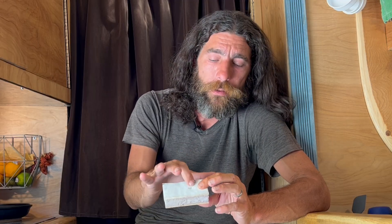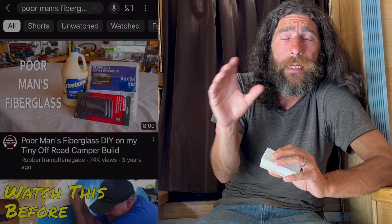Somewhere in the middle between the screen and the structural stuff is canvas. A lot of people use canvas — that's what they call poor man's fiberglass. It's a whole subset of this foam building technique, used a lot on teardrop trailers. It's thicker and doesn't have as much of a grid pattern, so if you just want a textured painted look, that could work for you. I only used it in one spot — on my bed platform, just to try it out. It's harder to work with and takes more paint to saturate the canvas. But it's also an option.